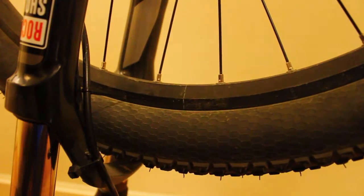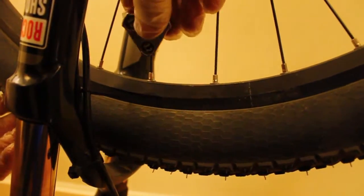I put a small cable tie on one of the hydraulic lines of the brake caliper. And as you can see, the cable tie end is moving quite a lot. With the cable tie, you can pretty accurately see where the rim is bent, so you can find the high spots and the low spots. Now, this is one of the high spots.